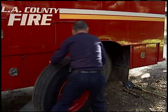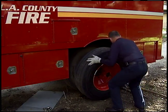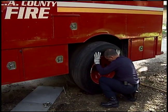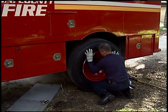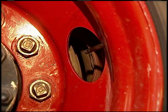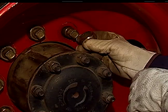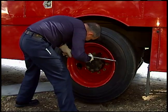In the same fashion as the inside wheel, mount the outside wheel with the concave side facing outward. Use a tool to lift the wheel onto the studs. Make sure to align the handholds of the rims with each other. The valve stems should be on opposite sides. Reinstall outer lug nuts and hand tighten evenly.